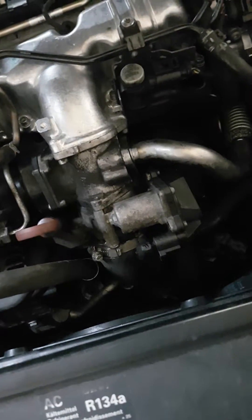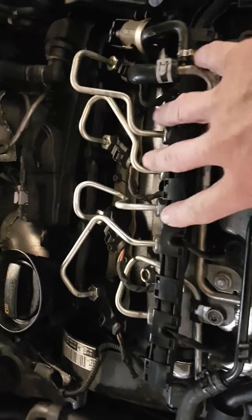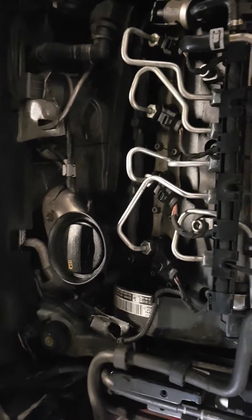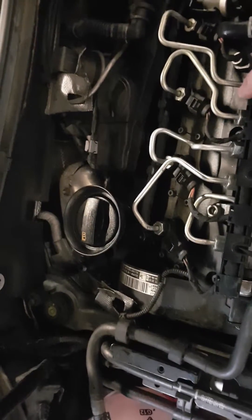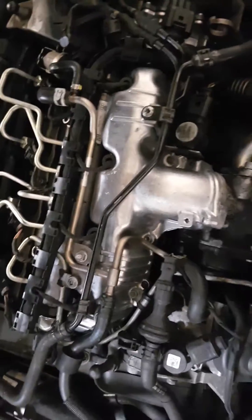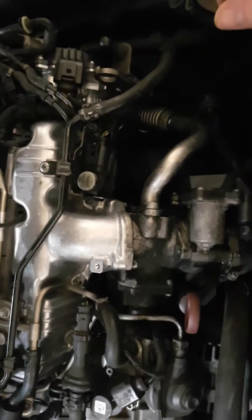Be careful that you don't just assume it's one particular flap motor and swap an expensive part unnecessarily — make sure you identify the right one first. Swapping the manifold out isn't that much of a job: it's just all your pipework off, your injector harness, and the glow plugs which just pop off. You've got to take your common rail off along with your injector pipes. The EGR and intake manifold flap motor will all come off with the manifold, so you can unbolt those when it's off the car, which makes life easier. Don't forget you'll need your diagnostic software to clear the fault codes, and whilst you're in there clean out your EGR and intake flap motors along with any other excess carbon you see.